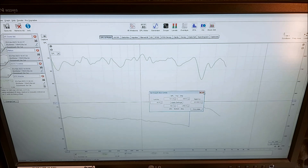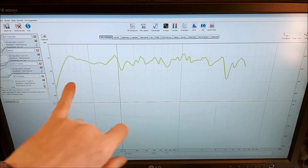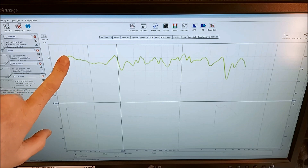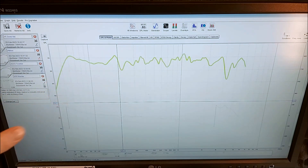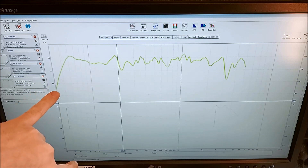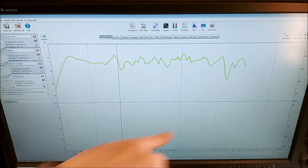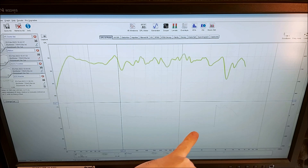Very, very similar to the bass performance that you'd get from the Studio One or the export monitor. Once we hit about 50 hertz, we really start rolling off. This is a 5 dB window, and once we hit about 55 hertz, we start rolling off quite steeply. We've got very good bass output down into 40 hertz — we're kind of 10 dB down, which is a lot, but it's still really good bass. We perform pretty well right up to a kilohertz, and our phase is nice and consistent until we get into the 2kHz region.